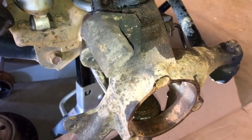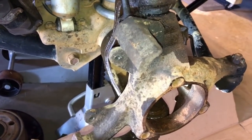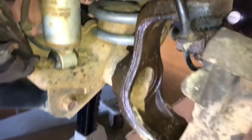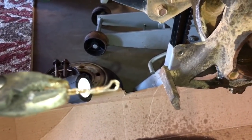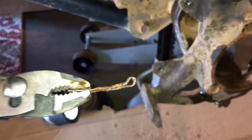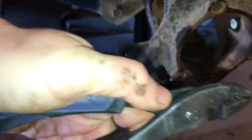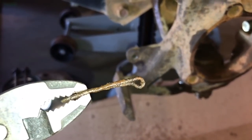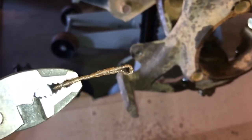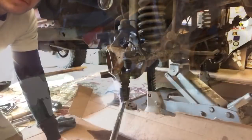Sometimes the simplest tasks can be a real pain. If the cotter pin breaks off, you can take a very small hole punch and punch it through, but be careful not to break the hole punch inside the hole. In my case I couldn't get a hold of the loop on the top one — the bottom one came out fine. What I did was grab the cotter pin with pliers on one end and hit the butt of the pliers to punch it out, and while holding on to it the whole thing slid out so I could get around the loop with needle nose pliers. That's an option if the thing doesn't want to come out on its own — sometimes you just have to get creative.